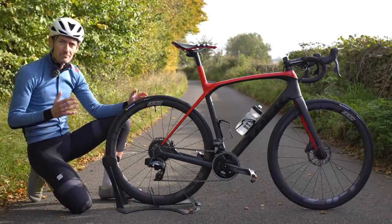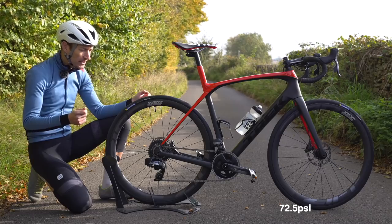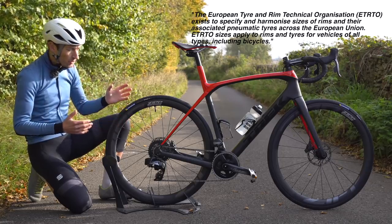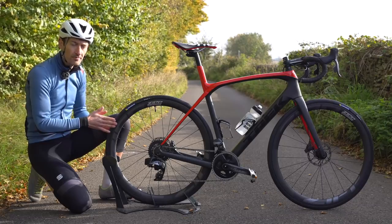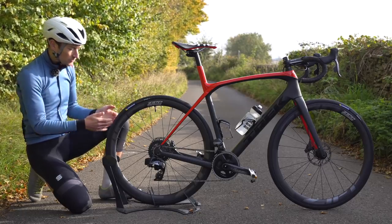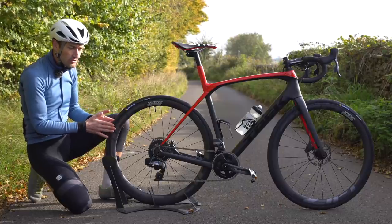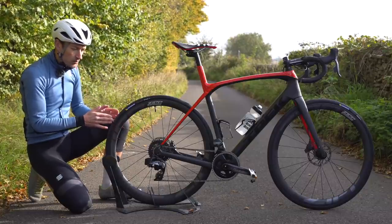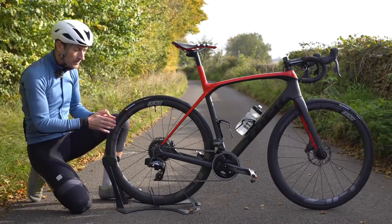There has been a lot of discussion this year around maximum tyre inflation pressures for tubeless tyres on these new hookless rims, which have a maximum pressure of around 73-74 psi — a recommendation from the ETRTO governing body. The reason for a hook on a conventional hooked rim is to act as a prevention measure to stop a clincher tyre blowing off the rim. The move to hookless — a trend from the mountain bike industry adopted by brands like Enve, Hunt, and Zipp — means you don't have that bead to secure the tyre, so the lower pressure recommendation is a safety guide.